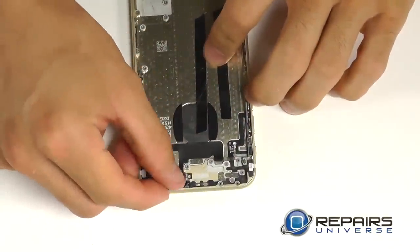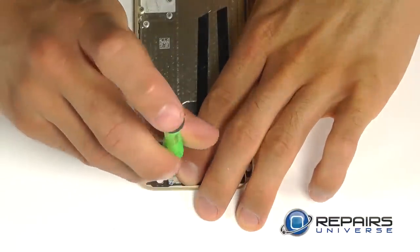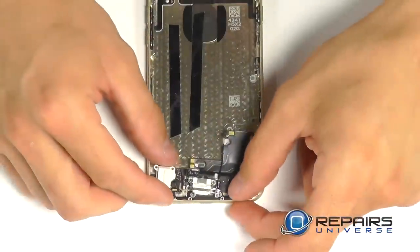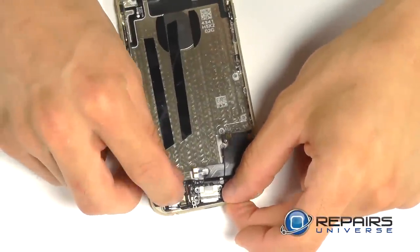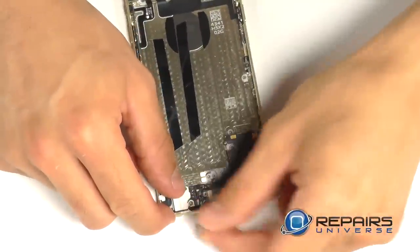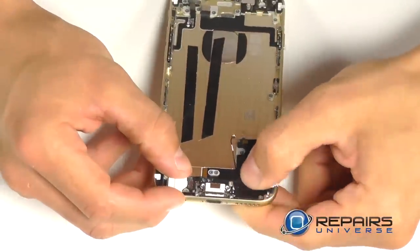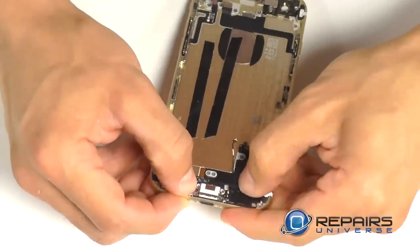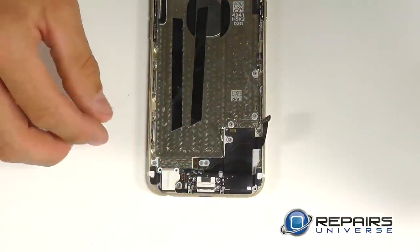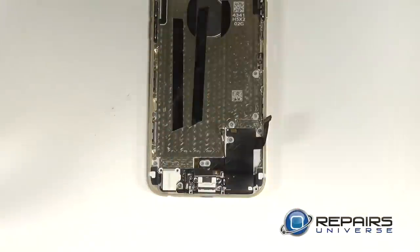Next, position the back plate for the camera flash — you only want to secure this with the single Phillips screw down at the bottom. Next, we have our dock port. Maneuvering the dock port back into place is a little tricky — start on the headphone jack assembly side first and get that positioned properly, then work your way towards the center, the lightning port, and properly press down on the ribbon cable. Once the dock port is seated, position the bracket that's just behind the lightning port connector and then secure the entire assembly with the nine Phillips screws.